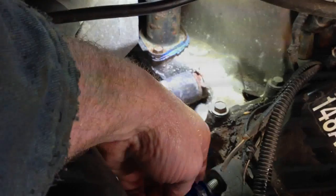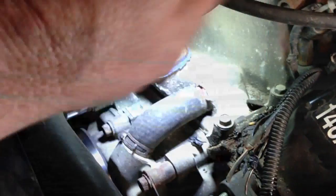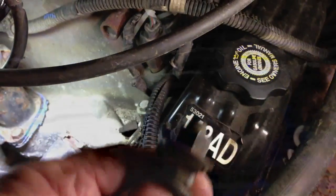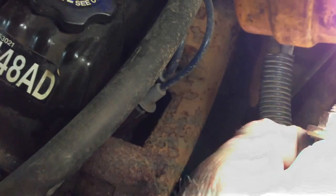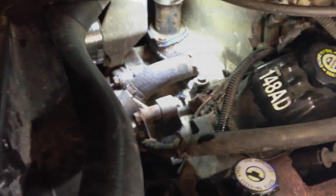We've got the new pump in place right there. The lines are now put on — the high pressure and the return line, very simple. The high pressure has a clamp fitting; the other one has just a hose clamp line, and there's really no pressure there at all. We have the bolts back in — three of the big long bolts down here. This one here looks like a stud, but it's actually a bolt with a stud on the back side of it. There are two wires right here — these are ground wires, as well as one for the battery. All the lugs are broken off. So what we've got to do is put that in the vise, heat that up, and take that nut off. We'll put a couple of new lugs on those wires, then I'll show you how to put the serpentine belt back on, put some fluid in her, and it'll be ready to go.